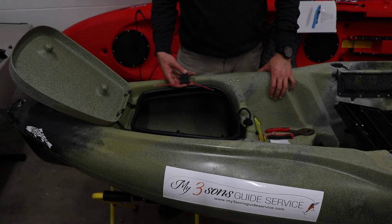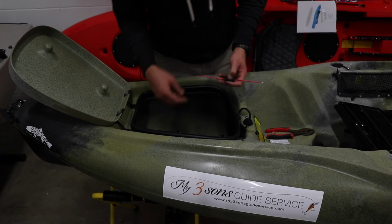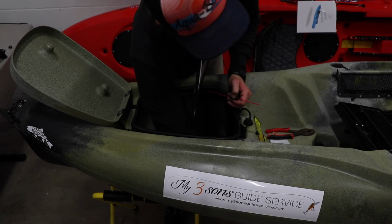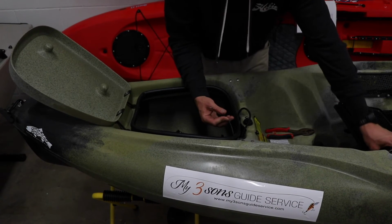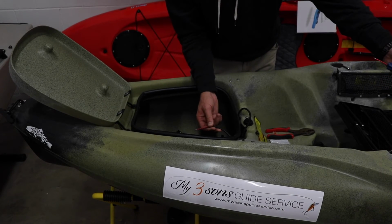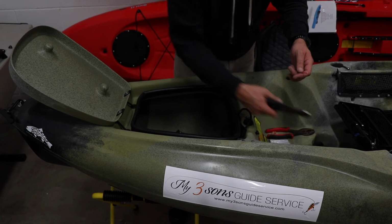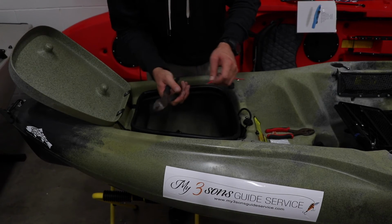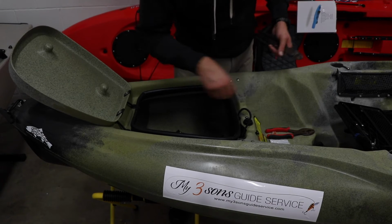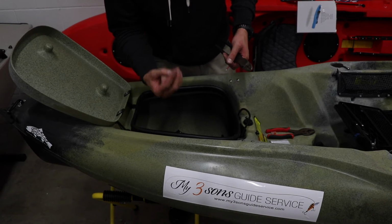Okay guys, so go ahead and find the fuse holder that you got with your fish finder and the power wire that comes from our through-hole fitting that we just installed for our fish finder head unit. Now you may have to strip back some of the wire's sheathing or insulation to make them fit in the waterproof connectors that you got with your install kit.